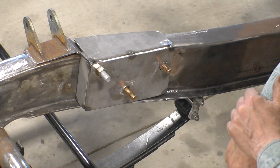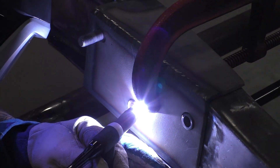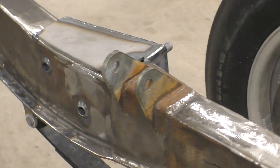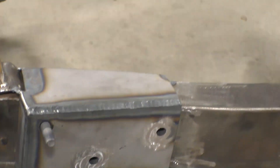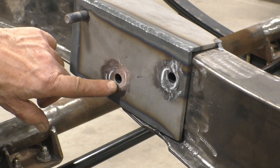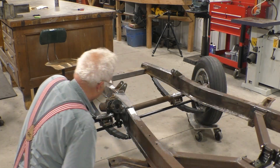There's no way we'll crush that, and we have a nice firm mount for the steering gearbox. Here we are welding up the sleeves to the outside of the frame and tacking the sleeves to the bracket. This bracket's not going to come off very easily anymore. Now we're tacking the bracket to the frame. Here's a good look at the sleeves protruding through the frame. Walking around the other side, the bracket is finish-welded but only tacked in place — that's so if disaster arises and we have to move it, we can still get it off the frame. We'll put a new chamfer on the end of the sleeve because we lost it when we ground it flat.